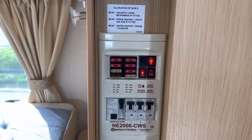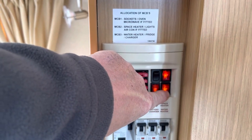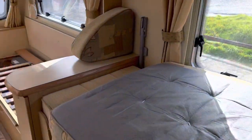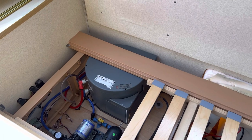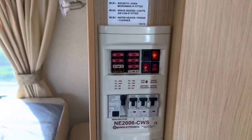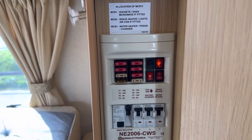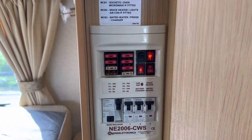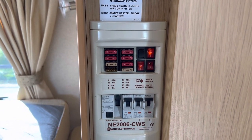The main reason is that when you disconnected the 240 at the end of last season, if you don't turn the water heater switch off — which in this case is this one here — when you then drain down the water heater, what happens is when you plug in your caravan for the first time in the spring, if that water heater switch is left on, the element will warm up without any water in the system. By the time you've come in, put the water pump on, and got all the water through, it's been heating up and will trip out for safety — it's like boiling a kettle dry.